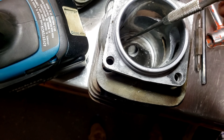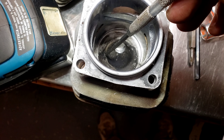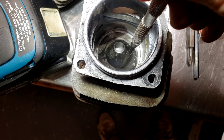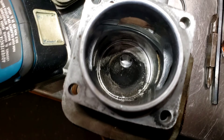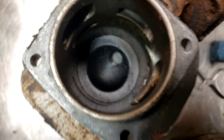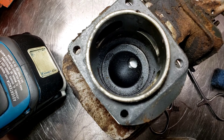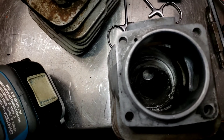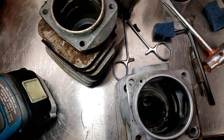The squish band comes all the way out clear over into here — that's it right there, that's all there is for the combustion chamber. So I can see how guys make these into real strong runners, that's for dang sure. Not that the 288 isn't, but it is night and day difference in the size of the combustion chambers.